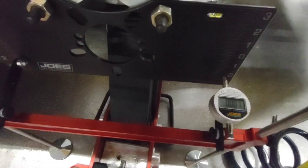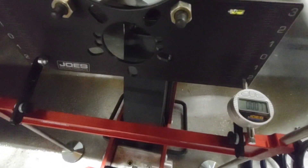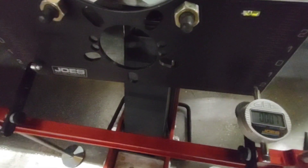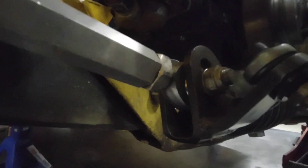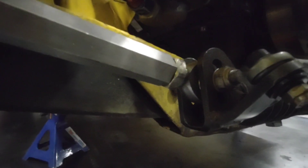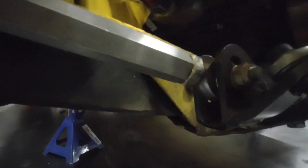There's not a lot we can do about that — that's about as good as you're going to get it. You've got to kind of swing through that middle. We're at 7 thousandths of an inch, which is about the thickness of two human hairs. I don't think the driver is going to feel that. The left front turned out about 3 thousandths, which is about the thickness of one human hair. I'm actually really happy with that — and that's how you set the bump. Here you can see where we wound up: right about in the middle of our adjustment range. We have room to go up or down, but we don't need it. Slide it up, slide it down, get it where you want it, tighten it down, call it a day.